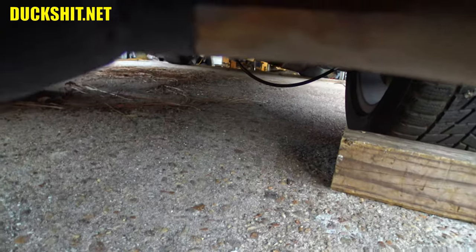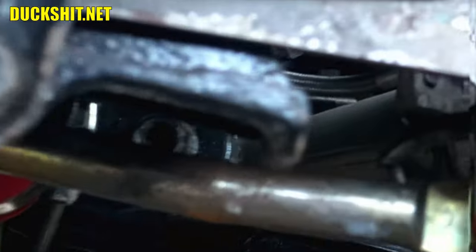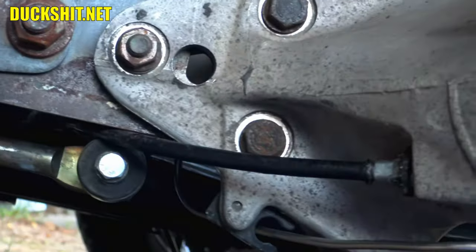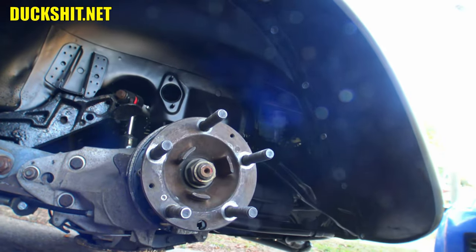See that cable dangling there? That is the e-brake cable on this side. Kind of affects ground clearance, and I can see that very easily getting snagged on something. Come around back on this side. And look at what I've done, because now the cable's shorter. It took the natural route that it's supposed to through the little clip that's supposed to hold it back to where it needs to go. So no longer is it affecting ground clearance, and no longer will it be an issue with snagging on anything under the car. Okay, this wheel's ready to go back together.